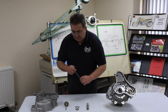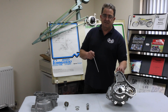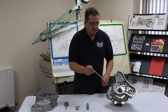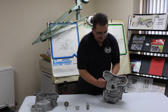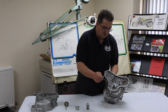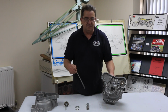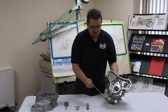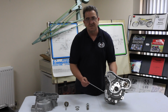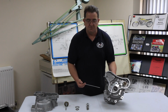Now, the best thing to do is to get used to knowing where your oil level is. Think where the oil is and where it could be. When you stop the engine, the oil in the engine, in the timing cover, will eventually work its way through the seal here, through the bearing, into the sump. So in the first 24 hours, that will be the majority of oil in the sump. From there on in, as that volume grows, what the oil pump is wet sumping into the sump will be the actual amount, not the initial amount in the first 24 hours.